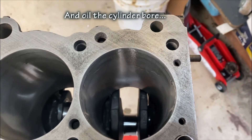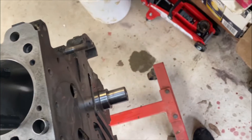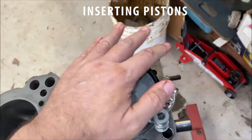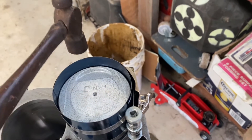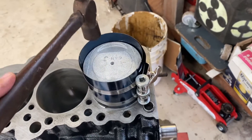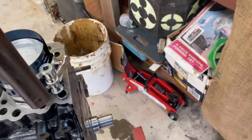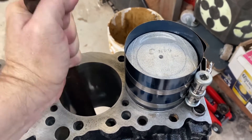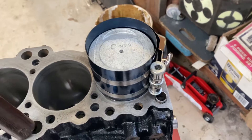Make sure you turn your crank around so that the bearing is as far down as it can go. Put it in lightly and go around with a small hammer, just making sure everything's nice and level with the surface. The idea is not to strike the piston like you're going to hit something hard — you want to hit and push all in the same motion, so it's a nice through-hit, not a surface hit.